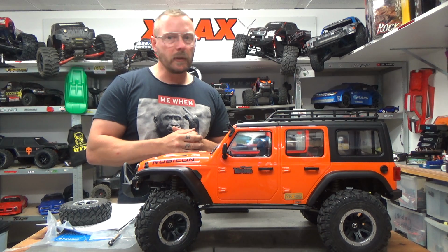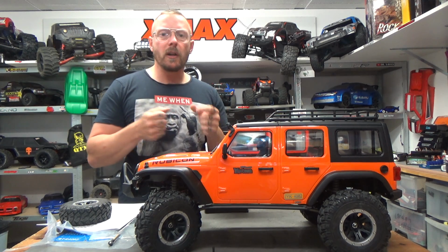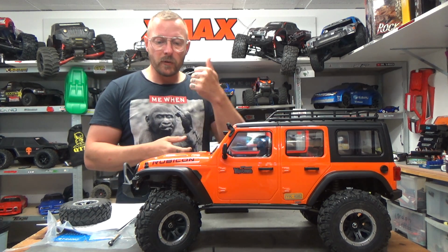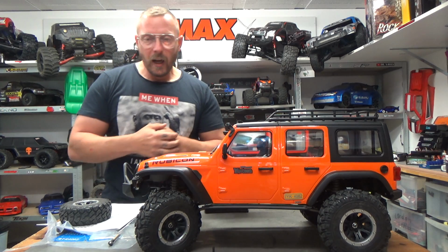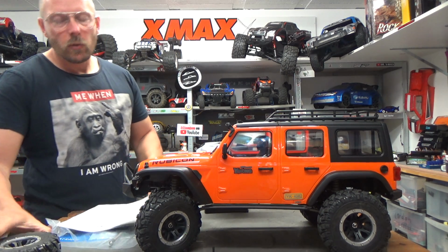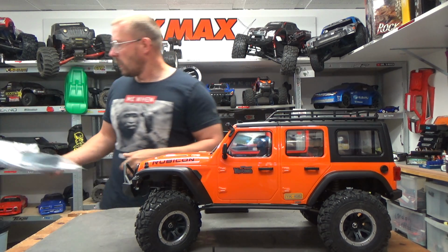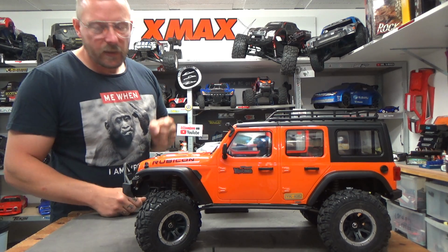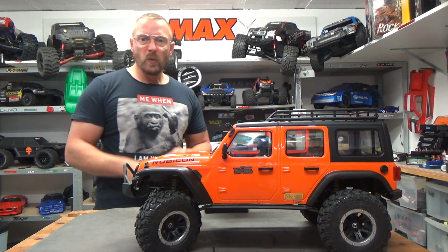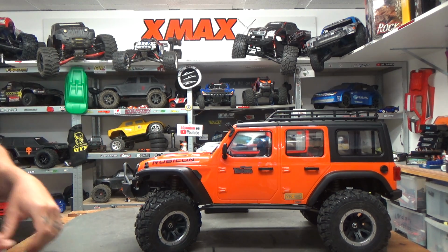I promise you, you're not going to forget it. You only drive once without the sway bars connected on a high lift truck on the highway. Because you hit the throttle, you feel, oh, my truck is strange. Then comes the first curve, the first braking, and then you will see, shit, I forgot to connect the sway bars. I know it because I tried it. We really go off-road, and when we go back on the road, we say, oh, why put this thing on? Come on, let's drive home. Let's drive to the car wash to clean the mud away. We drive 200 meters, then we stop and we clean the stuff and we put all that stuff in, because it's really dangerous to drive this way.